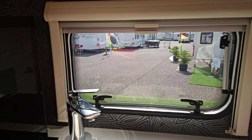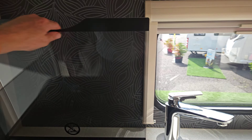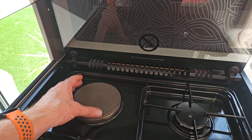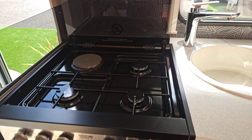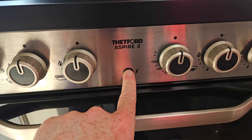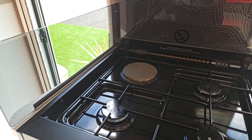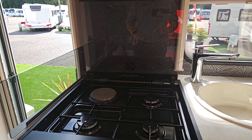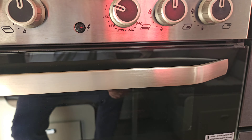Let's talk about the kitchen. All the windows have blinds and fly screens if they open. When travelling, make sure the hob lid is all the way down. This hob has three gas burners and one electric burner — the electric one is 240-volt only, so only when plugged into mains. The gas runs from the gas bottle — make sure you've got enough gas and have turned the bottle on. The igniter button is in the middle; hold it down and press the ignite button to light. When you first turn your gas on, light one of these burners and leave it on for a minute or so to purge all the air out of the gas system — everything else will light much better afterwards.